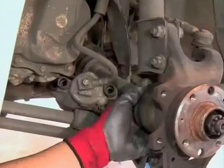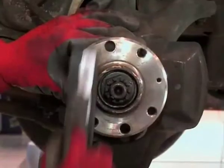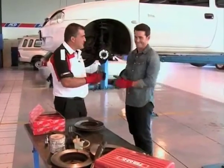After a quick safety inspection, the cleaning process begins. It's important to have a clean face for the disc, so use a normal steel brush and run it in a straight line. It looks good now. Now it's time to have a look at the new discs that we've ordered.